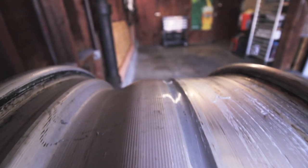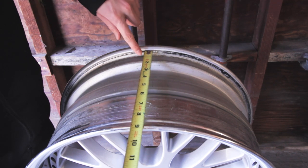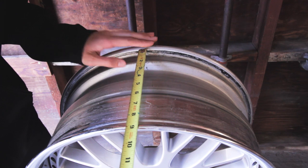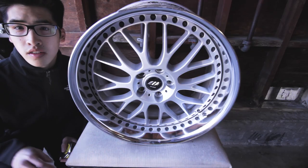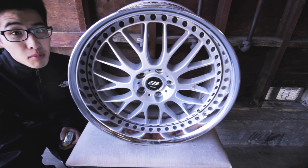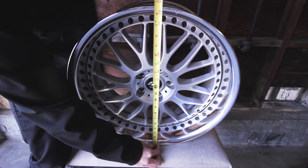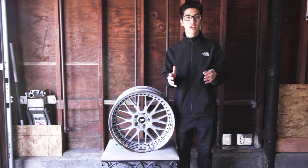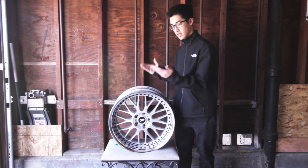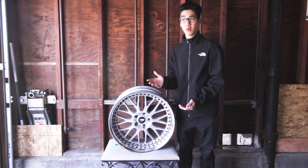Moving on to actually measuring the wheel — as you can see it measures out to nine and a half, which is what I initially thought. How you actually measure the width of the wheel is from the bead, like the edge of the lip, to the other bead on the inner portion, which turns out to be eight and a half — and that's correct. Also, the actual diameter of the wheel differs from the given number: this is a 19-inch wheel but the diameter ends up being 20 and a half inches, which is an inch and a half off. So measuring the full width and diameter isn't accurate — you have to go between the beads and account for it being about an inch and a half bigger than expected.